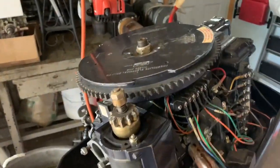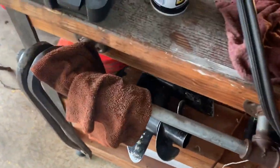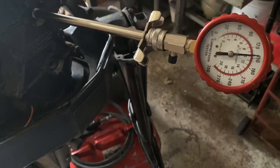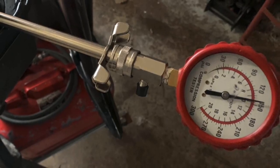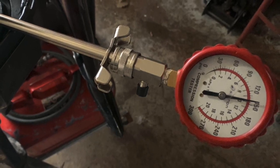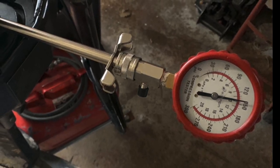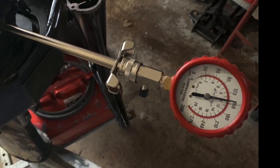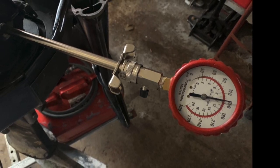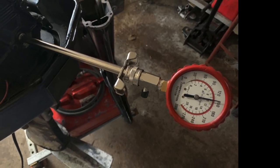While I'm waiting for parts, I played around with this parts motor — a 50 horse Force — and you can see this motor is not stuck. The owner thought it was, but I did a compression reading on it: 145 pounds in both cylinders. At least the owner knows now it's a viable power head. Stay tuned for part three where you'll actually see the motor running and can verify that it shifts in and out of gear properly. I'm still waiting on the impeller — it's been two weeks. Thanks for watching, and don't forget to subscribe and give me a thumbs up.